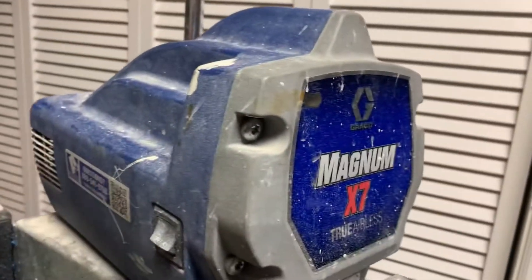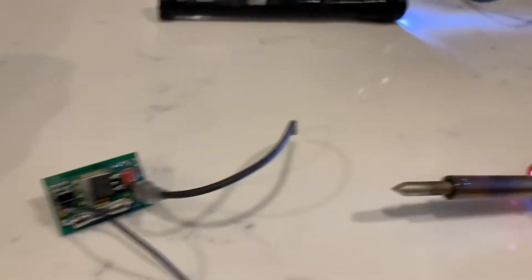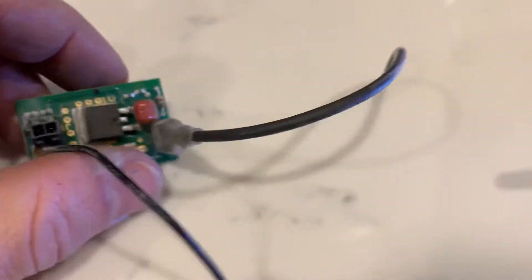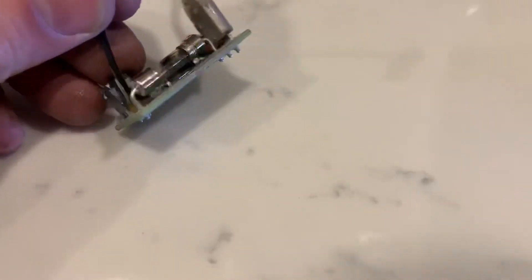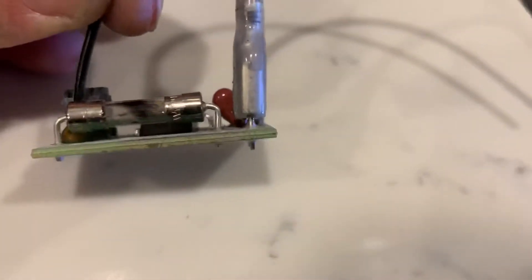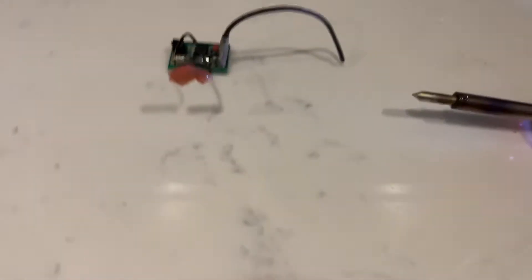T20 is on the outside perimeter of the casing and T30 in the front. Once you split it open, you'll see this little green board with the soldered-in fuse. Here's the fuse right here — you can see it's obviously blown, it's got black on the glass, and it is soldered in.